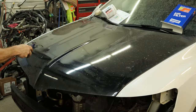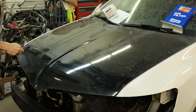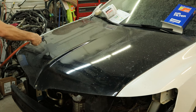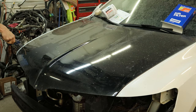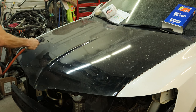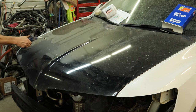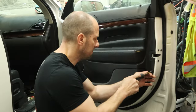Now I'm going to do a little body work myself. We're going to remove this clear coat — it just takes a little air. Turns out when they repainted it, they didn't do such a good job. Maybe they let it sit for too long before they put the clear on, maybe cheap materials, I don't know. But instead of sanding it all off, we're just going to take a blow gun and blow most of it off. I quickly lost interest in this, so whatever I didn't get with the blow gun, the painting gnome actually used a razor blade to scrape the rest of it off. Then we reprimed the whole hood so that we don't have a problem with our new paint.